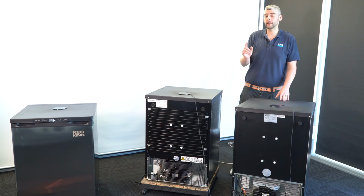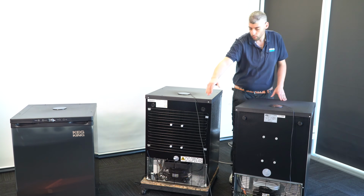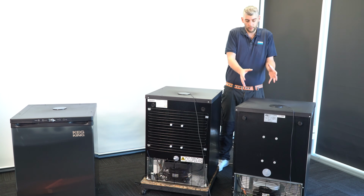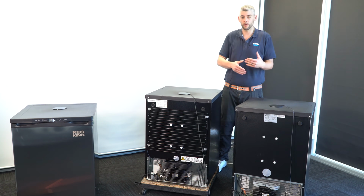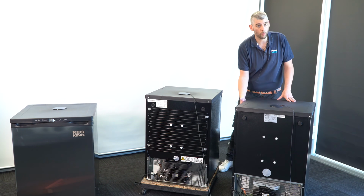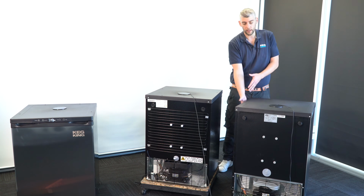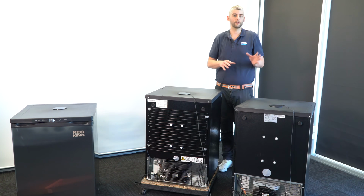On this fridge, which does have thicker walls and thicker insulation, the main reason is because the cooling lines, which are warm, are inside the wall of the fridge. Now, in my honest opinion, it doesn't make any sense to have the insulation and the cooling and the warmth generator at the same spot. What you want is to have good airflow for the heat to dissipate very well. This fridge will have very, very warm sides when the cooling lines are in action, when the compressor turns on and off. Essentially, it will keep heating, and then some heat will seep back into the fridge, so the fridge will keep working a little bit harder than it should.